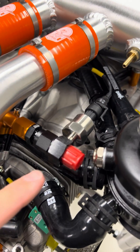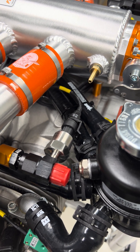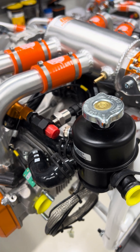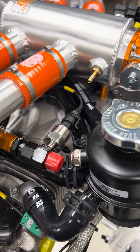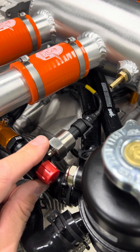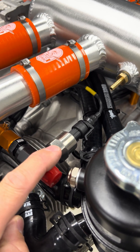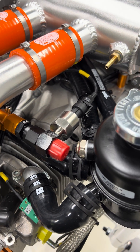The second change we have done is that we have now incorporated a fuel pressure sensor directly to the fuel rail, so the ECU both sees the fuel pressure — which is handy because you don't have to have an external one to display your fuel pressure on your EFIS system; that will all be broadcast now by CAN bus from the ECU to your EFIS system. Another great feature is that the ECU will now actually see the fuel pressure going through the fuel rails, and if there are any deviations caused by a bad fuel pump, a clogged fuel filter, or low voltage, the ECU will not just see a change in EGT and AFR but also sense an increase or decrease in fuel pressure and make timing adjustments on the injectors to compensate for that. So that's another very clever safety feature.